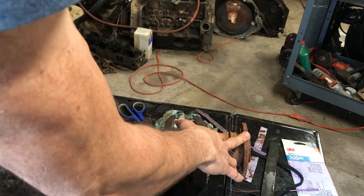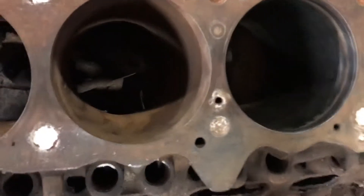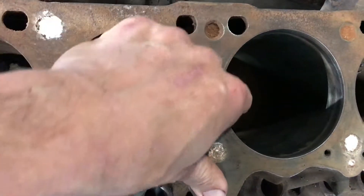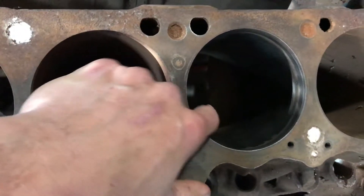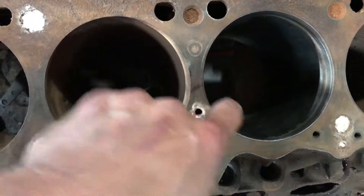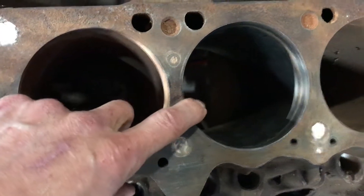Being these were the two worst ones, I feel like I'm good to go with this crank and can possibly reuse it. I may reuse my stock rods and just buy pistons for the block. The only roadblock is the cylinder ridge — it's a little worse than I thought. I got my ridge reamer and I'm going to try to take that out. With the dial bore gauge I'm getting about two thousandths of taper from the untouched area at the very top — midway seems okay. If I get the ridge out, hone the cylinder, and get the cross-hatch back in, I'll double-check for out-of-round. Two thousandths taper would be about a thousandths per side — I may be able to live with it.